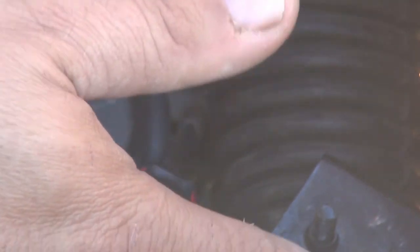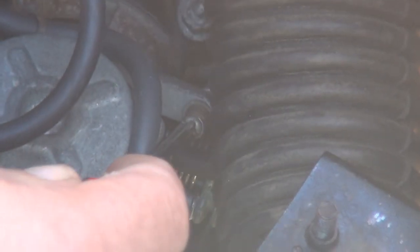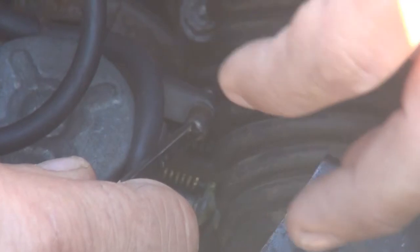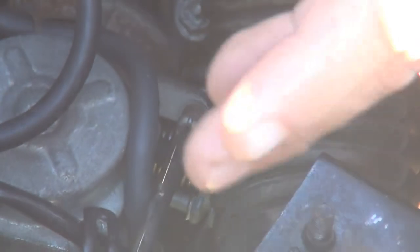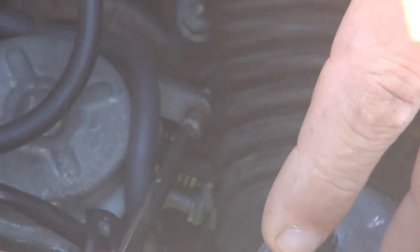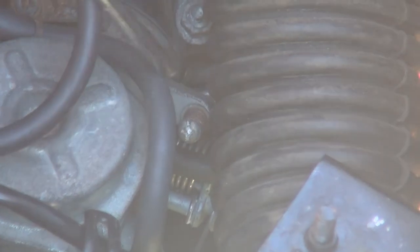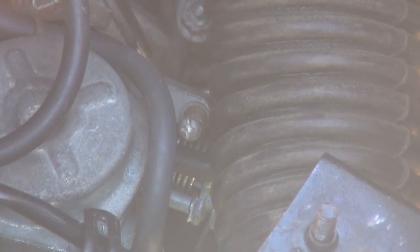You need to have an RPM that is relaxed for your scooter. When you stop at a traffic light, you want an RPM that won't push your scooter but will keep it running. You don't want the RPM too low or your scooter will die when you release the throttle. Also, the higher you set the RPM, the more fuel you will consume. To summarize: turning right means higher RPM, turning left means lower RPM.